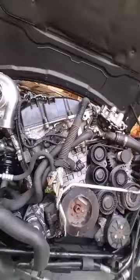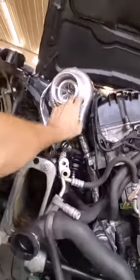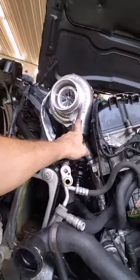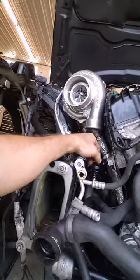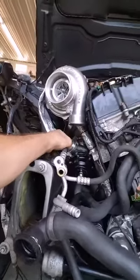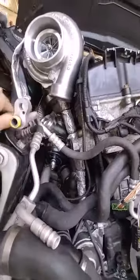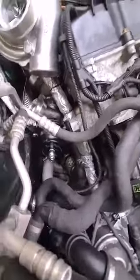I've got to drill a fitting into the turbo so we can have the best boost readings possible for your maxi-solenoid and boost gauge. I also have to relocate the O2 sensor — I did verify the gray one is bank one, which is forward. We're going to move it to that location right there.